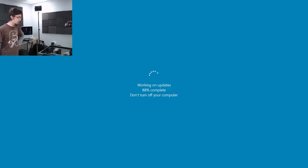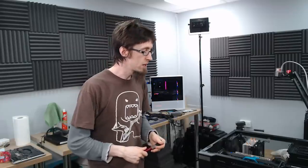I'll probably give this thing a quick once-over service just to make sure it doesn't fall over, but I'm assuming we're all good to go now. Thank you everyone for tuning in. Took a little bit longer than we needed to, just because I got sidetracked testing other components that weren't faulty. That was a very funky slew of beep codes we were getting — possibly just a cautionary tale that beep codes are not gospel. Every beep code and error message is information, not a diagnosis. You look at all of that information and use it to draw a conclusion. Thanks a lot for watching. See you next time.